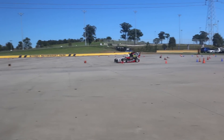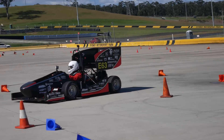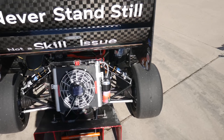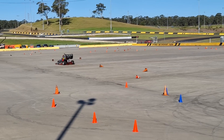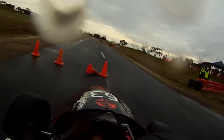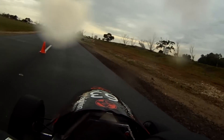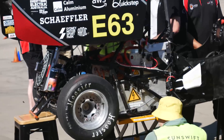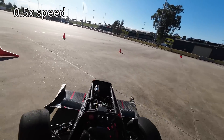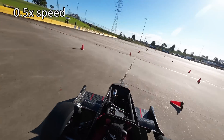A huge amount of the behavior of these cars is driven by the fact that they're constantly in a dynamic state — rarely in a long corner, it's typically quick slalom. So their performance is massively driven by yaw rate, which generally means the front axle and turn-in are a limiting factor. On the rear end the car was extremely planted. Being an electric car, the first thing you notice is that the torque response exactly matches the demand you give it at the throttle. On older SAE cars with combustion engines they were generally tuned to not have great mid-throttle characteristics and could be a little bit spiky. The electric completely gets rid of this — the car is much easier to handle and very easy to get the power down out of corners. Most of these corners I was just hooning out of on full throttle to get a nice little slide going, but out of the hairpin I was always trying to manage my traction carefully and the car was really easy to drive in that sense.